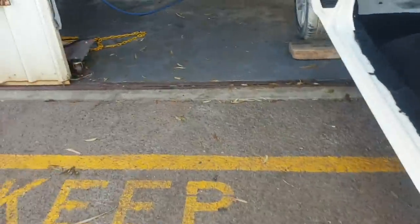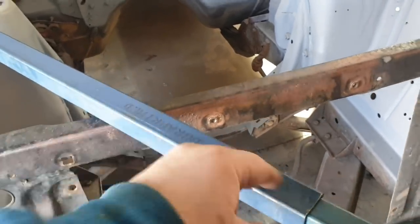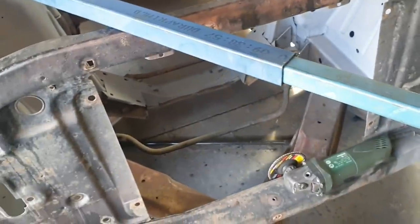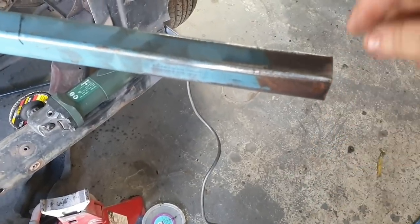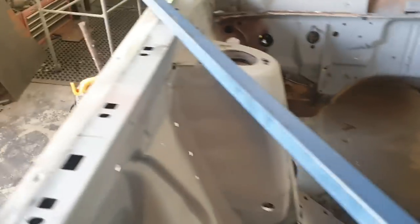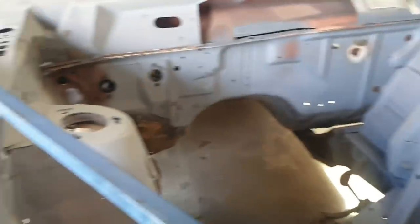I'll be building a trammel gauge. You might ask — what's a trammel gauge? It's a tool, a piece of equipment you'd use in the crash shop. You can buy really fancy ones, but it's nothing more than a way of measuring. I had one when I was working at Highlander Crash where I started my apprenticeship. You get a small bit of square tube, slightly bigger square tube, so they slide in each other. You weld it, drill a hole, put a nut and bolt through it so it's adjustable. On the ends you have a little rod that's height adjustable as well. You put it into points of the body, do your lengths, put it into a point that you know is the same on both sides, measure the length, then turn diagonals and work out if the car is square.